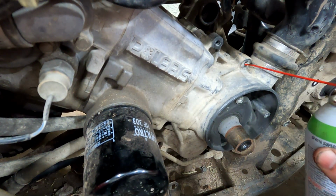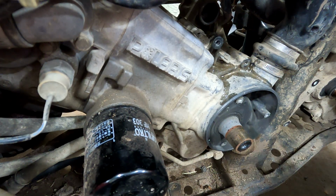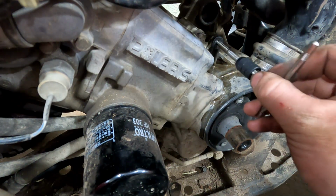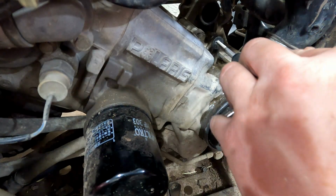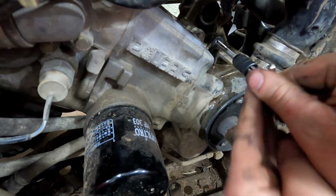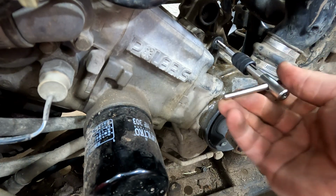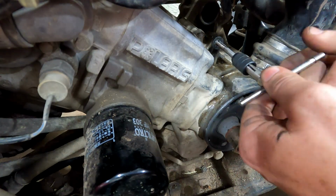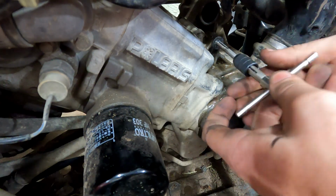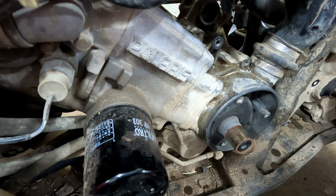I'll spray a little bit of lube in each one. Now, being these were a metric size, you can kind of get away with stepping up to the standard a lot of the time. So what I got here is a 1/4 by 20 thread. And it's aluminum, so it threads fairly easily. Clean that off and run it through again.